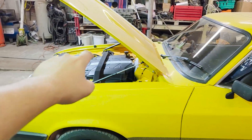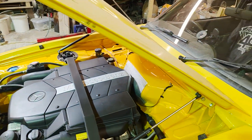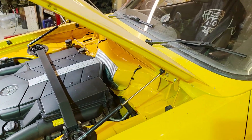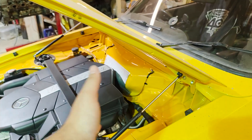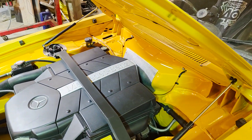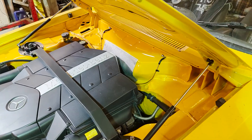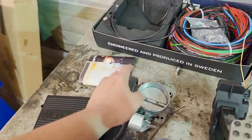I had to custom make a manual throttle body, which does work but it's not perfect. I could never get it to close fully because I repurposed an electronic throttle body — they weren't designed to close fully. It's just been a bit of a pig. I put springs in there, then used an idle control valve, and that control valve just failed and was a pain. So I've decided the far better route is to go back to an electronic throttle body.